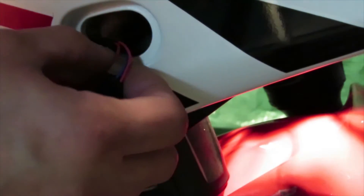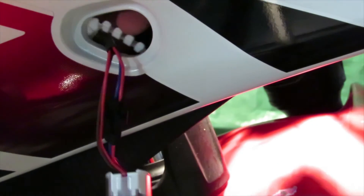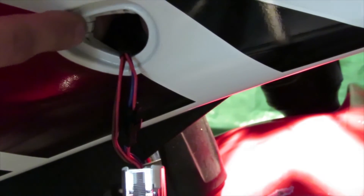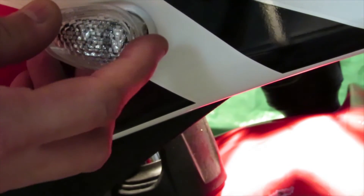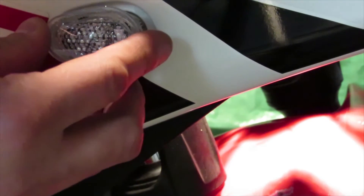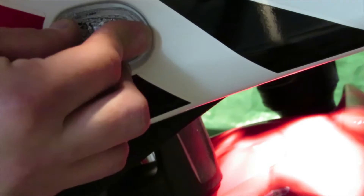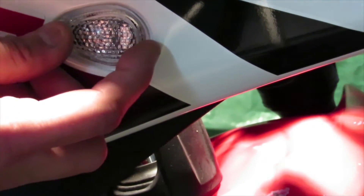While getting that little plastic circle piece in place, make sure you have it in the right position with the bigger part of the circle facing the front of the bike and the smaller end towards the rear. Hold it in place, line it up to the circle of the hole for your flush mount, then with one finger on each side pressing against the fender, feed the flush mount through and you should start hearing clicks as you press it in.